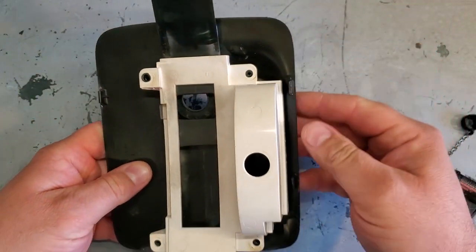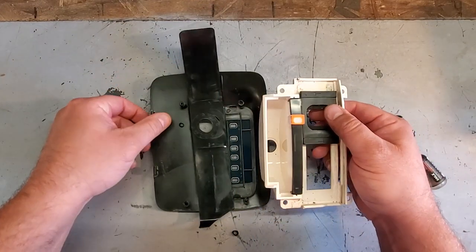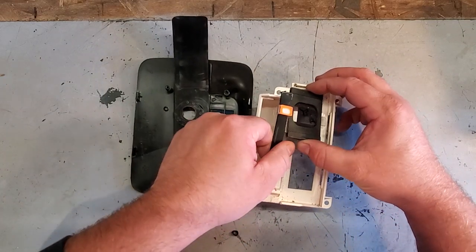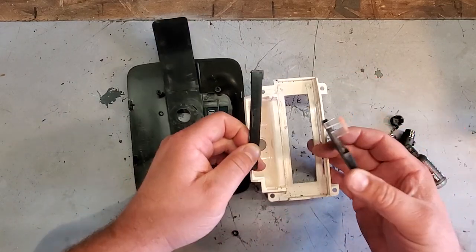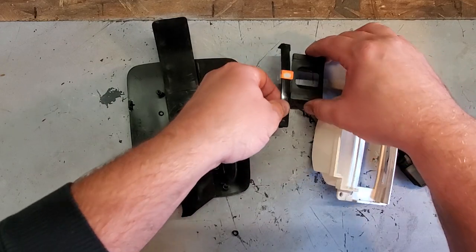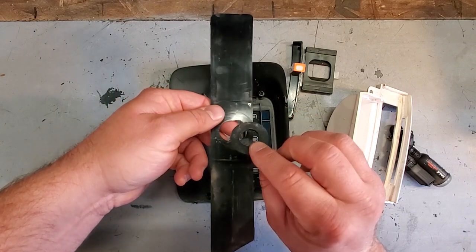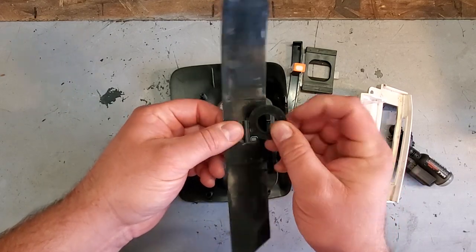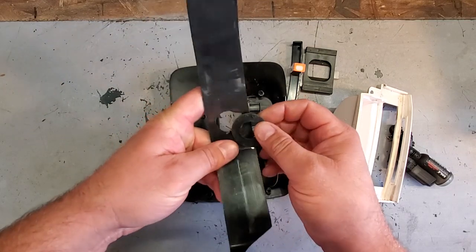Flip it over and you will find it's got four little plastic welds, and we are going to ruin them. What you do is take your trusty little butane torch - we're gonna go ahead and pop these little plastic welds. Right there, just like that - give them a little melt and pull them right up. All four are melted. Now we're going to separate the two. Here it is - here's the shift indicator. You're going to want to make sure you remember how this all goes back together. This piece slides up and down on here, so I guess this is the track for it. Here's the housing. This just sticks with the ribbed part up, so don't forget that.